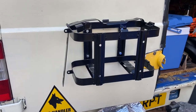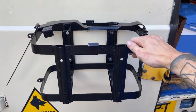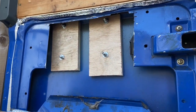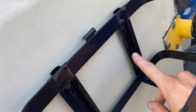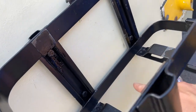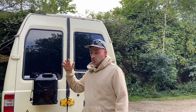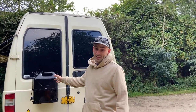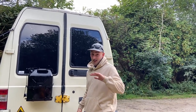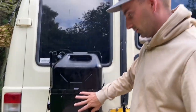Get this cut down, get the jerry can holder on, then probably have to go and get a jerry can. Let's see how it looks. Right, got it on — this is a bracket for adjusting what size jerry can you've got in. Got to re-insulate and strap this back up, and I've given the bolts a bit of black spray paint as well just to give them a layer of protection and stop them corroding too quickly. Finished it! It's the next day — yesterday you saw me doing all the prep work, just got too late to film anymore. But the most important thing is it's on, and I think it actually looks pretty decent. I'm quite happy with it. What I've done as well — it's not perfect by any means — is put that scrap bit of metal I cut off the inside of the door onto the front of it, and that looks alright.